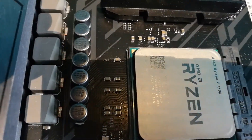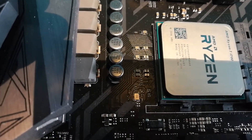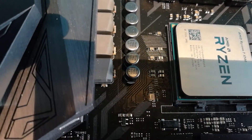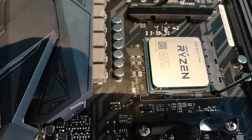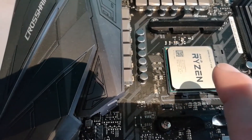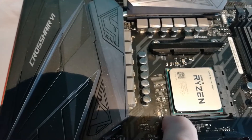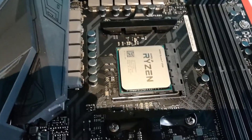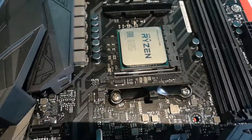As you can see, there's a little gold arrow on the processor that aligns with a tiny arrow — which is quite hard to see — but there is a similar triangular arrow embossed on the plastic of the socket. Once we've got it in, you just push this lever back down. You'll feel it under tension as it squeezes the processor to make contact. And that's it.